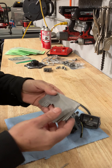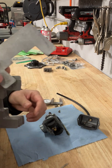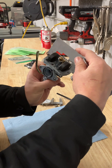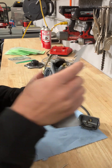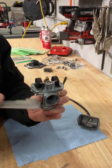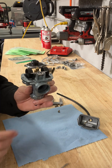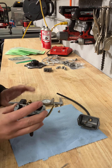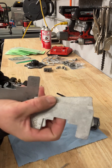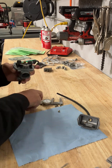These are handy little tools for setting the float height — they're marked and you can just slide them over and check it, get it set to whatever you want. There are adjustable ones as well. These ones don't go to the level we've been using on the green slide restricted classes — we go significantly over the 875.